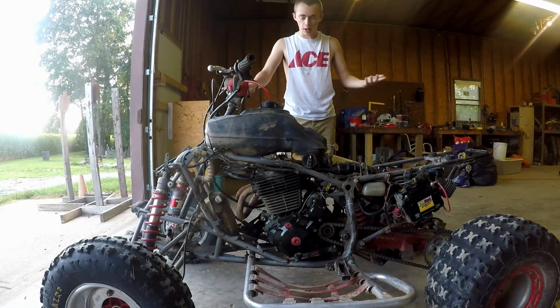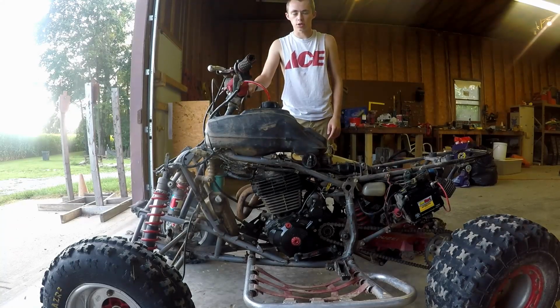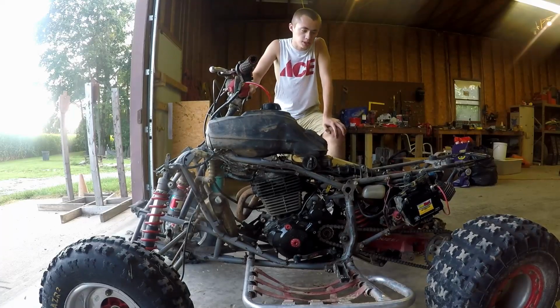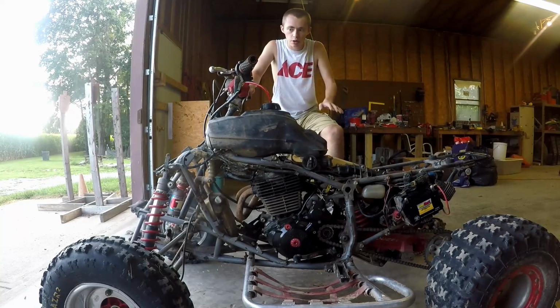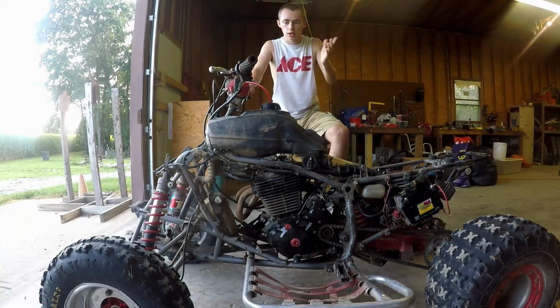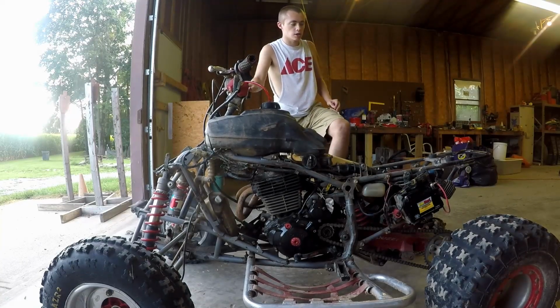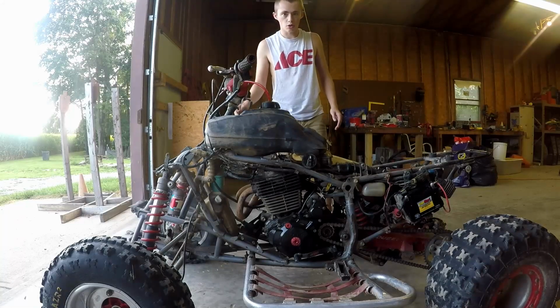Cycle on it. There's a million different ways you can break these engines in. Every person you ask is going to tell you a different way. Some people are going to say start it up and ride it like it was stolen, and then other people are going to say, oh well, you want to heat cycle it 4 times, and then ride it easy for like 4 hours, and then ride it a little harder for another 4 hours, and then eventually, once you've got 10 hours of riding on it, then you can maybe start riding it hard. So it's literally all over the place.